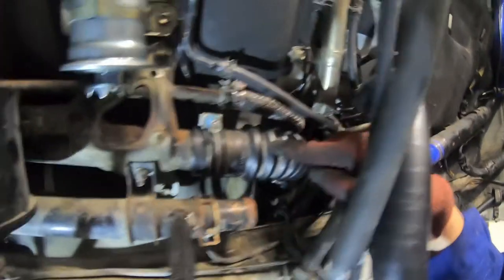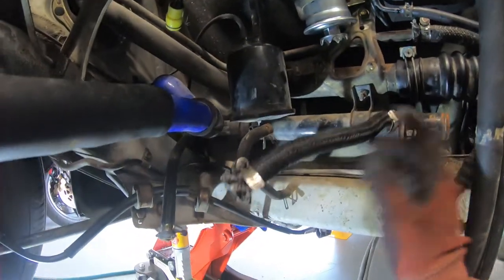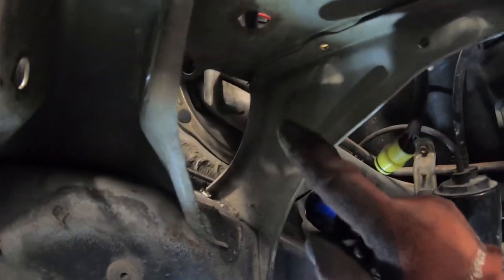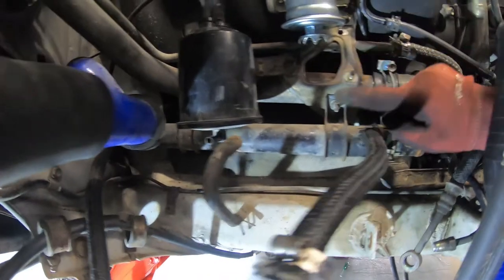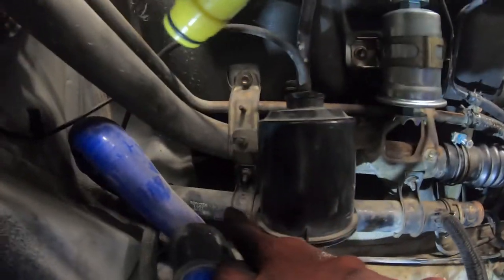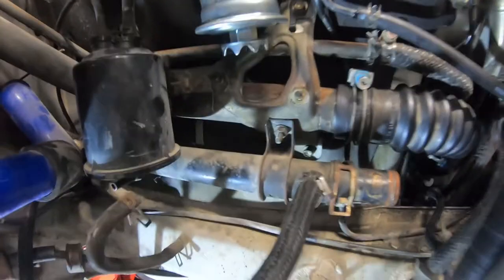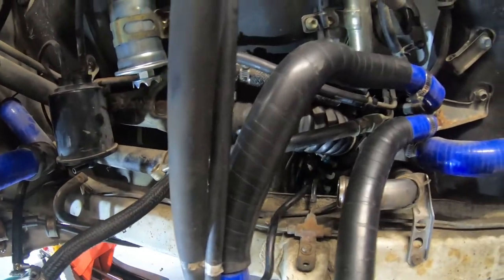I don't know how easy or hard it is for most people to get these units loose, but I ended up having to remove this pipe here which connects to this hard line — there's oil that comes out of this, I'm not sure if something's wrong with my car. I had to loosen this unit too; the entry to the tank is wobbling now, so I don't know if I've busted something, or maybe now that I've bolted it back in place it'll be okay. That was just 14 mil bolts — one on the side, one on the other side to drop this unit, then 14 mils: one down there, one up here which connects to the fuel filter, and another one there. You have to remove these to get in; if you had a flexi joint you're probably alright, but I ended up beginning to round them so I just removed that piece. So the fuel system, except for this bit which I need to put in, is pretty much all plumbed in now.